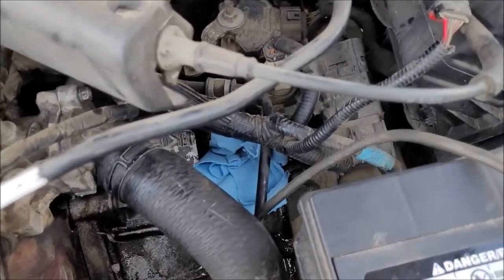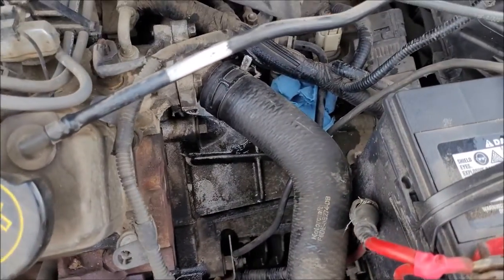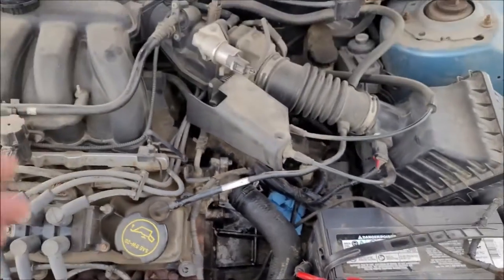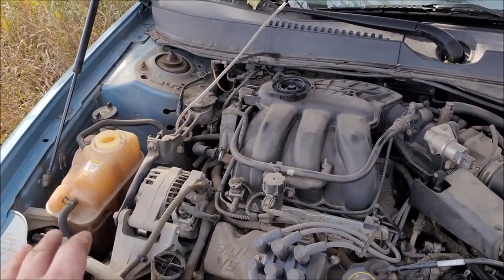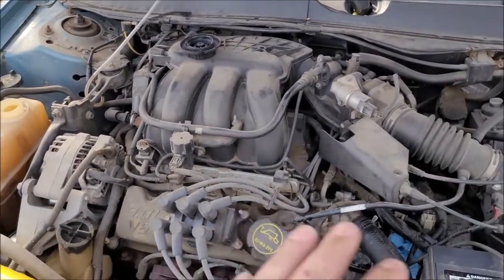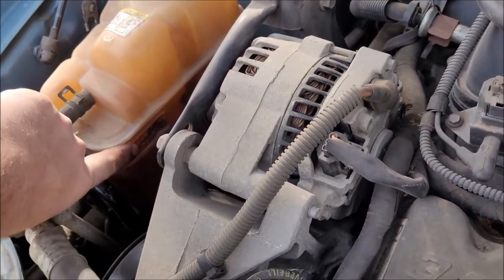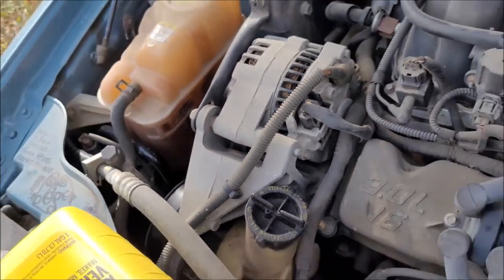You see where I got that rag? There's just a little pocket in that aluminum casting of the transmission housing that holds a bunch of fluid — you're going to want to clean that out before you take it out on the road. Watch your coolant level until it gets up to temp. The first couple of times you drive it, check again and make sure you're topped off. You can see the cold level here — it should be somewhere in between those two marks.